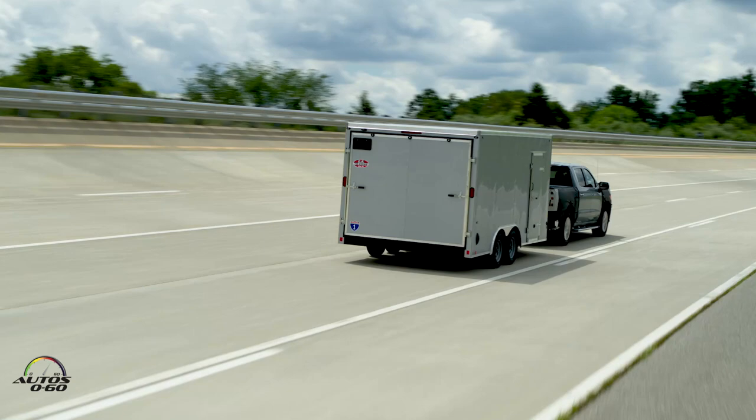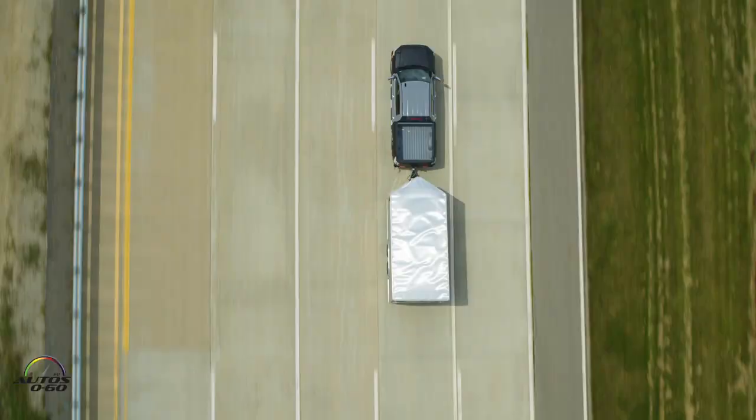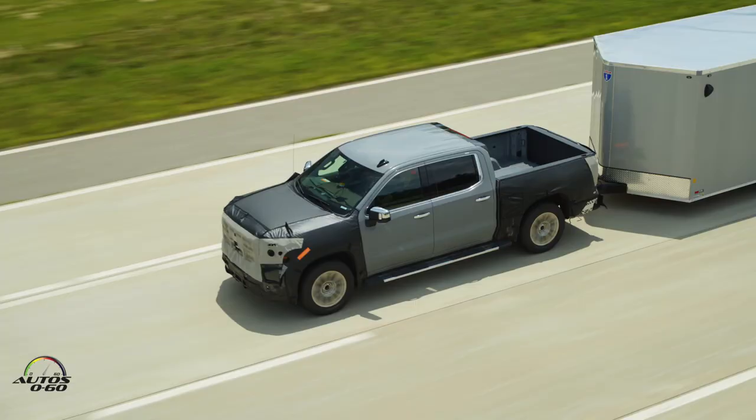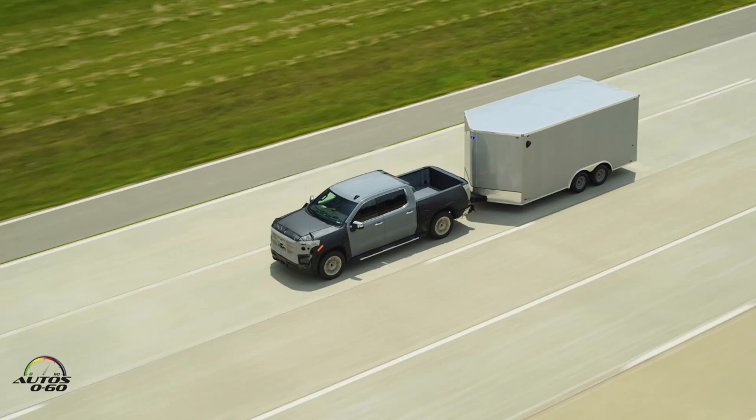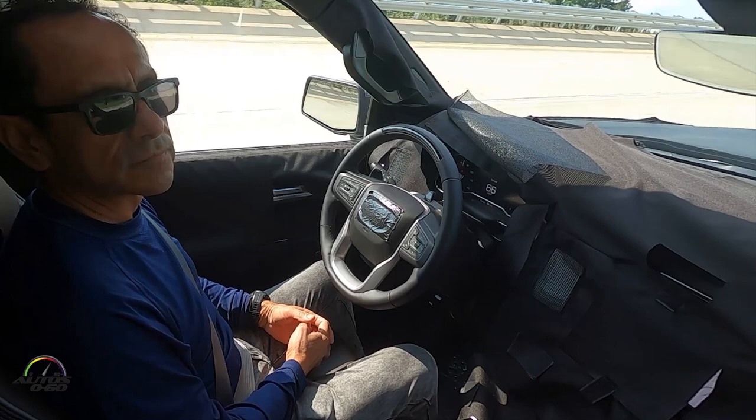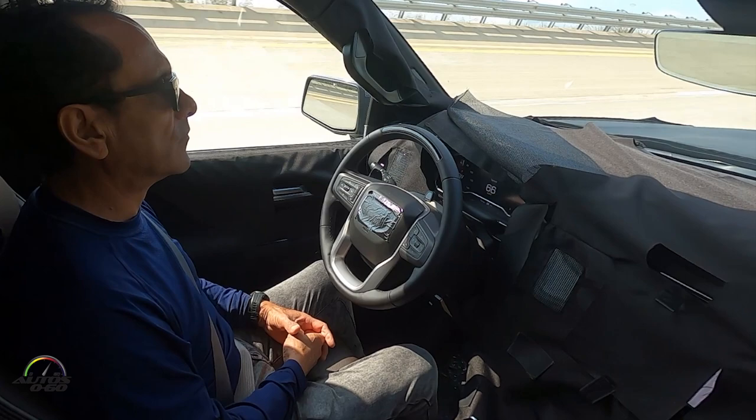So once we have a trailer detected, we also change our lateral and our longitudinal control. An example of the longitudinal control changes: are you familiar with curve speed control at all? A little bit. As we drive through a curve in Super Cruise, we'll reduce the speed of the vehicle. With a trailer, we're going to reduce your speed sooner, so the truck and trailer have come to a constant speed before the curvature, right? So we're going to exit the same place we got on here.